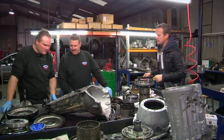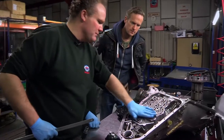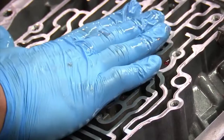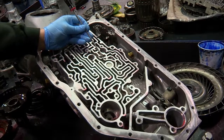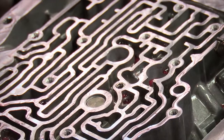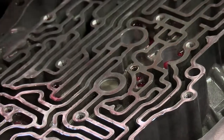So what's happening with this then? Have we got good or bad news? We found one concerning thing. When this transmission was built, this is a machined surface — very flat. These are the galleries. This thread here, at some point, has been stripped and they've put an insert, a helicoil, into it. Somebody overtightened the bolt into that and pulled all the threads out — stripped it. The problem is the insert hasn't gone all the way down; it's sticking proud. Oh, it is, yeah.